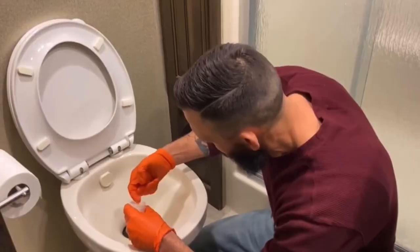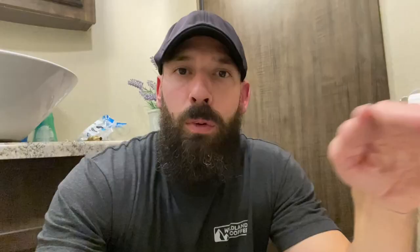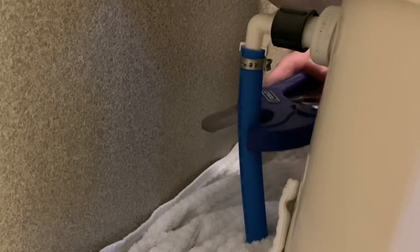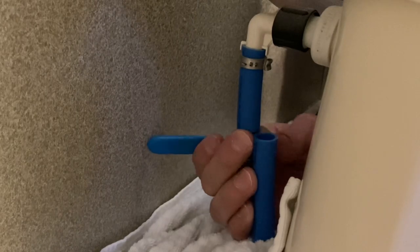The toilet is the most important one because it's probably most likely to have leaks around the base, and you may want to replace it at some point. On my monthly maintenance, I'm always putting some plumber's grease down around the ball valve in my toilet to keep it lubed up so the flapper always opens nice and easy — and you have to shut the water off to do that. I'm actually sick of going outside all the time to shut the water off to put the plumber's grease in there. Now I can just shut the water off right here in the bathroom, do what I got to do, and turn it back on.